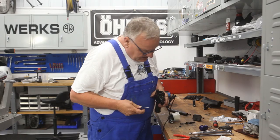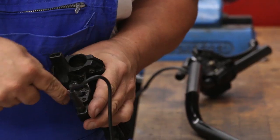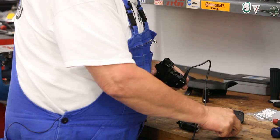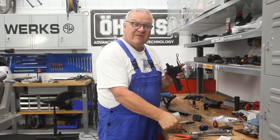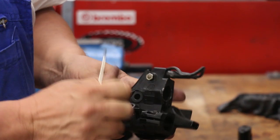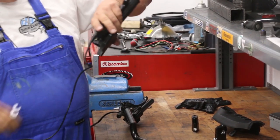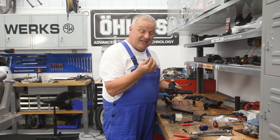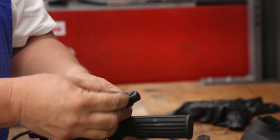On the handle body, a little metal shim comes out — there's a replacement with the kit. There's also a rubber seal to remove, and you'll notice it has a little step in it — the step goes in like that. A new one is provided with the kit. There's a lot of gunk in there from over the years, and the pivot needs to be cleaned. You can go ahead and take the brake light switch off, remove the pin to take the brake lever off — want to clean and lubricate the brake lever as well. Notice there's a little wave washer on there in the recessed side of the brake lever — retain that prior to cleaning.